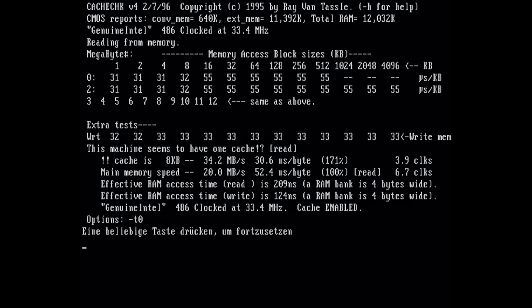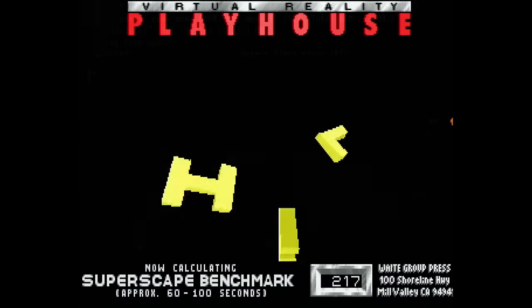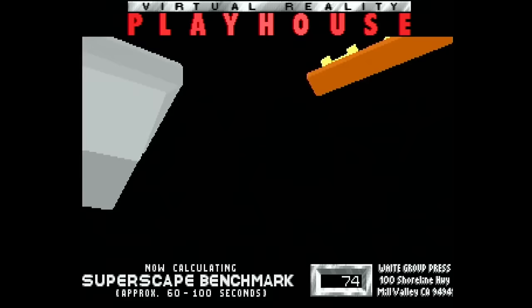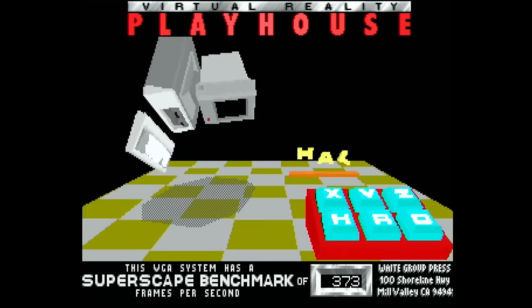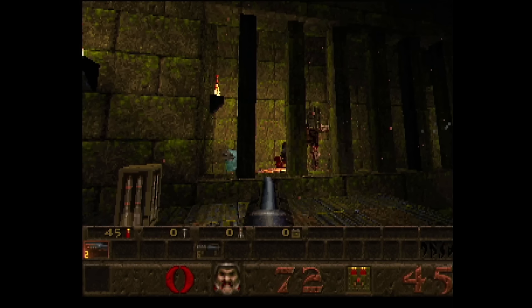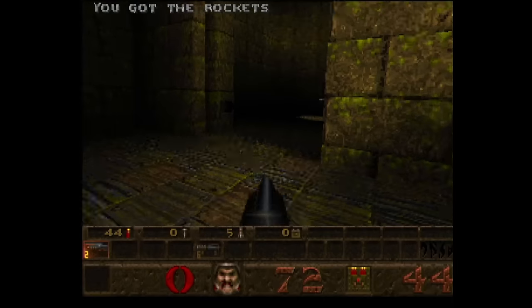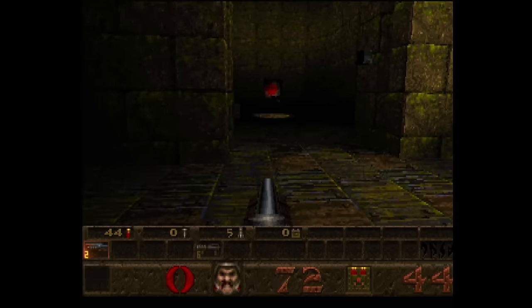I switched back to the 486DX33 CPU and repeated all the tests with and without the cache, and there the situation was the same. I tested some other CPUs and overclocked the DX266 to 80 MHz with no luck. Level 2 cache always halved the memory throughput. I started once again to test and measure various things, but couldn't find anything wrong. Eventually, I reached out to my wonderful Patreons, and one of the members, Magus, provided some links to check, also to an experimental BIOS which I tried, but they didn't help either.